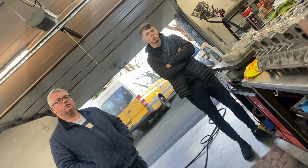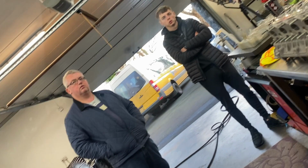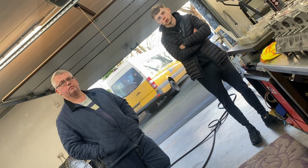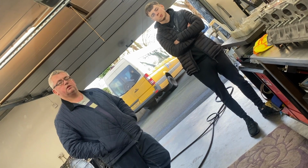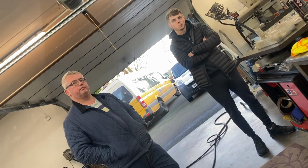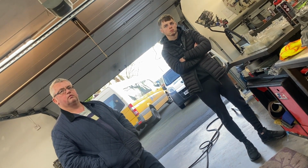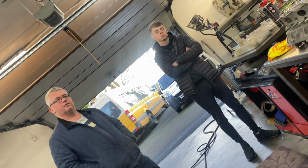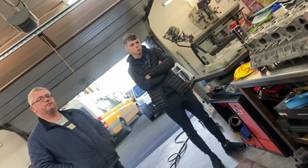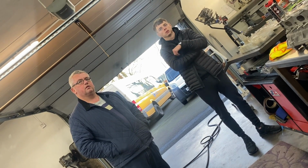It's all right. They do reasonable horsepower, but the problem then is as soon as you start going, which again, I know you do about 250, 300 horsepower cars, when we see around the 700, 750, it pushes the crank out the bottom. Right. Splits the block in half and pushes the crank out. Because what we do is we try and make it as rigid as possible. So we'll put a bracing girdle on, we'll wedge the block, but then it gets too rigid and it blows it out the bottom. Yeah, I would never ever use one of them, ever. I hang them in my garage. I hang them on the wall as ornaments.